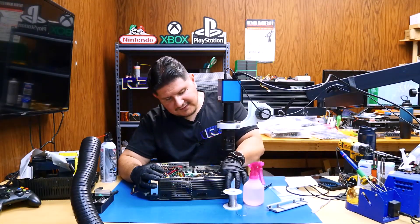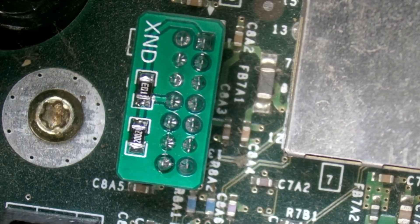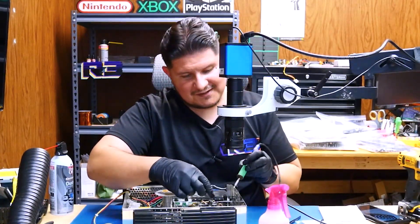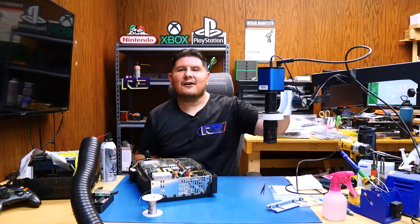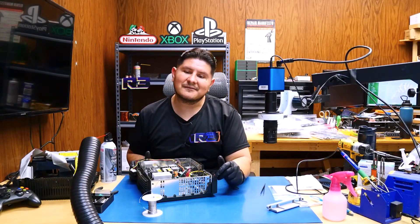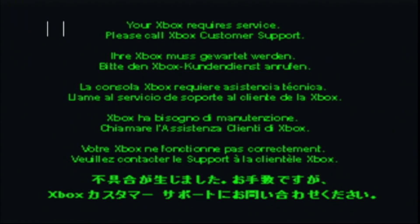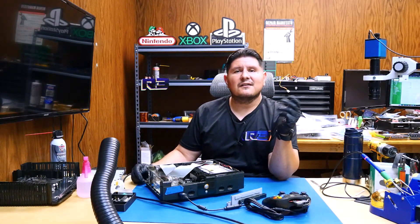Now to install this thing — it's only going to go in one way because it is keyed. That's how it'll look when it's in the Xbox. I do see a joint that looks like it could be touched up, so we'll go ahead and take care of that. Now that you have it installed in your Xbox, we can go ahead and plug it in — provided the thing doesn't burst into flames — and you'll be presented with error 11. The only way to get around this is to install a BIOS that has a no-DVD patch. You can also use a Stellar mod chip, which automatically detects and takes care of the no-DVD issue.